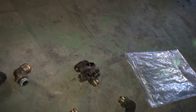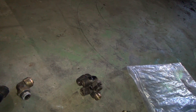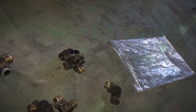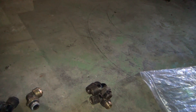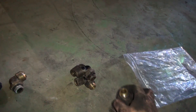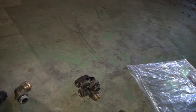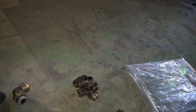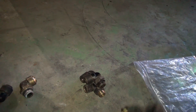I've got all of the fittings changed out on the back side of the tank. There's one more fitting on the front side of the tank. I kind of figured out what they were doing with the plastic fittings. These are all brass that come out of here. You have one large brass fitting right here — this is just a straight-through fitting. I believe this feeds your rear suspension, brakes, and trailer. It goes to the back of the truck and ties in, so this is your main line off your air tank.